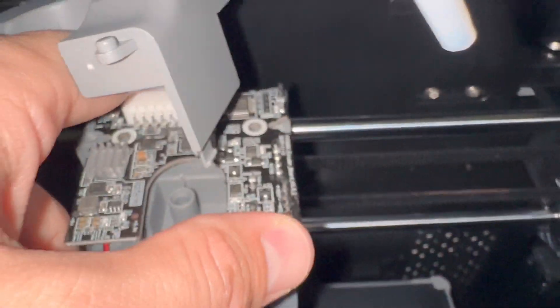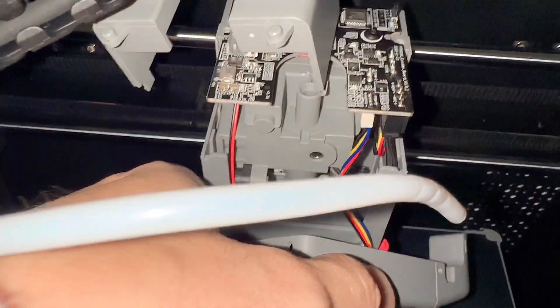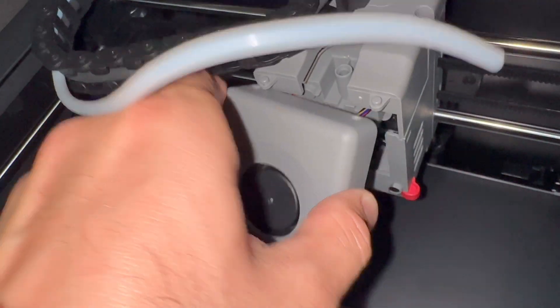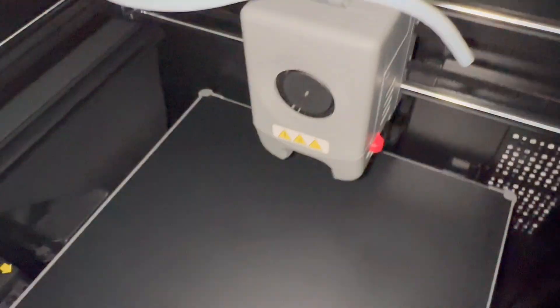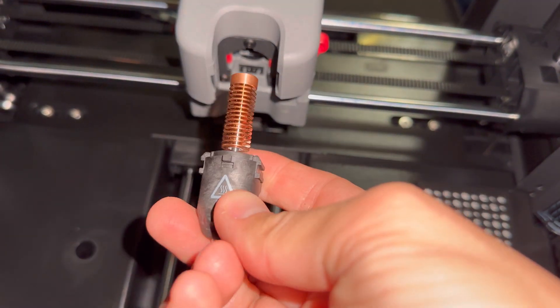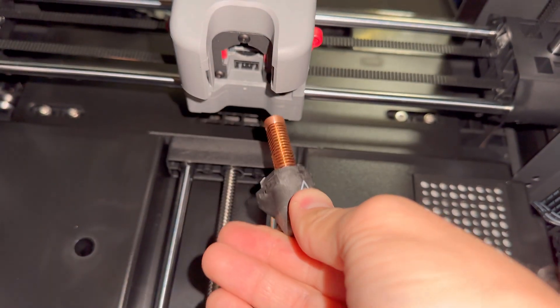You can magnetize the screwdriver for the two screws on top to keep things from dangling and prevent the wire from getting pinched. This piece does go on first — drop it down after you get your two screws, you'll hear it click, and then pop this other piece on. It goes on the top first and is magnetized at the bottom. You can run your tube down at this point. For the nozzle, the triangle faces you and the connector goes to the back — put it in straight up and that white piece will connect into the black connector. When you hear it click, it's fully inserted.